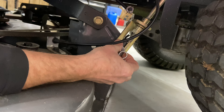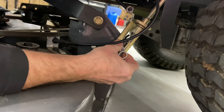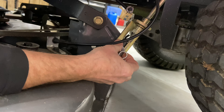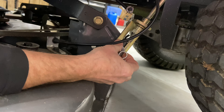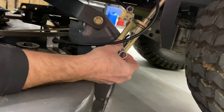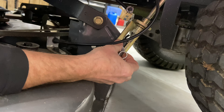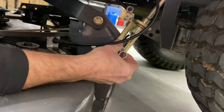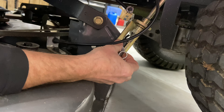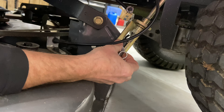Going to the other front wheel to grease it as well. This is a twin intake 22-horsepower engine, so it's probably going to take at least 2 quarts, maybe 2.25 quarts. This engine has a dipstick with two nubs on one side and one on the other — make sure you put it in correctly because you can put it in backwards. After changing your oil, always start the engine, let it run, then recheck the level.